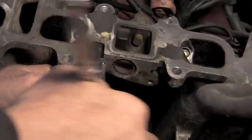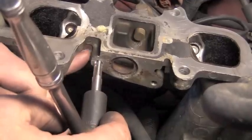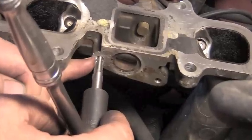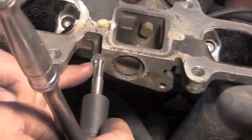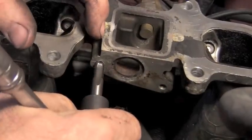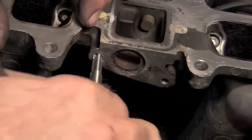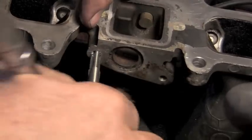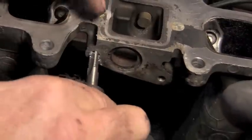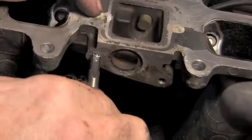Most of the time, these taps, as you can see, were probably a good 1/4 inch plus up in the hole, and we still have a lot of threads down through here, so you won't find it necessary most of the time to bury and use all of this. What you'll do is, as you're tapping up through there, you'll find it quite often will reach the depth of travel you need, and it'll start feeling a little more resistant to turn. With one of these, sometimes you'll get one of these shavings that you can see peeling out of here that'll buckle, and that'll give you some resistance. But you can also feel it when it gets a little stiff because it's reached the end of its travel